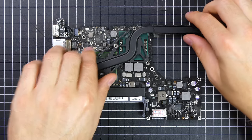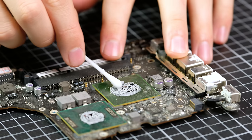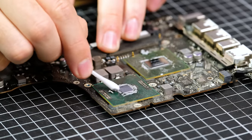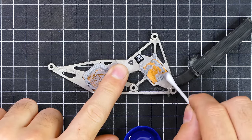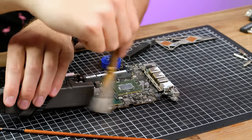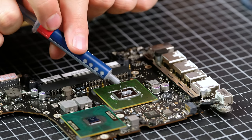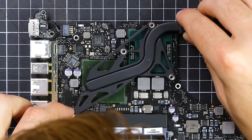The cooling plate seems somewhat cemented to the logic board — that is really some dried out thermal paste. I started removing it using some 100% isopropyl alcohol, which will leave the surface very clean and oil-free. The heatsink has also had its fair share of thermal paste, or should I say thermal powder as it's really that dry. I brushed off the logic board to remove excess paste and dust, then gave the processor dies one last wipe before applying the new thermal paste. I chose to use Arctic MX4 — when the cooler is placed back on, the paste will spread thinly over the surface.